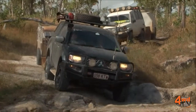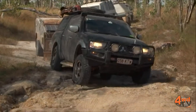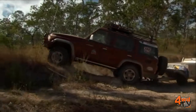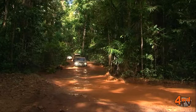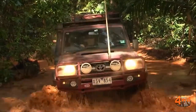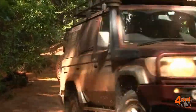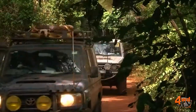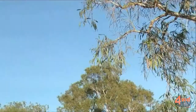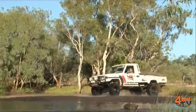These batteries are less tolerant to undercharge. The fact is they've got to be charged at a certain voltage, and a lot of the older cars don't do it. If we can't get that voltage up, that battery is not going to charge. It will wind down and subsequently it will stop starting your car. So you can have a perfectly good battery in a perfectly good older car, and it won't work.